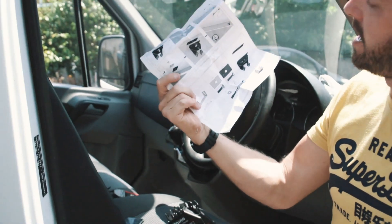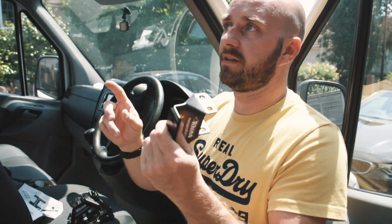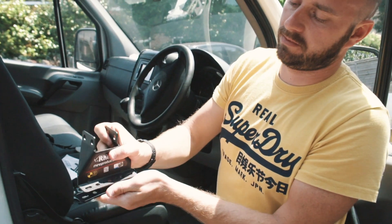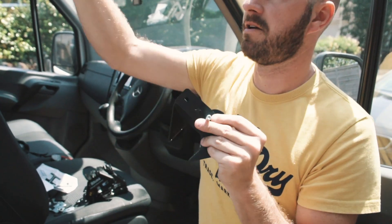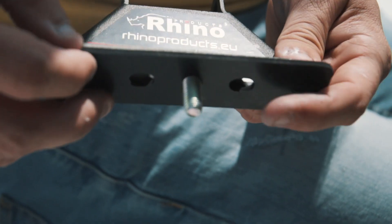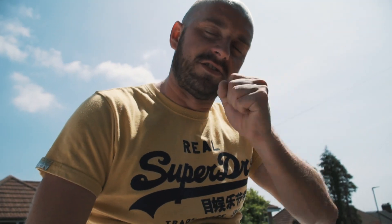The instructions are really straightforward - it's literally A4, two sides, just six images, but they're so easy to follow. It's actually one of the best instructions I've seen. To fit the bars on, you've got these heavy duty brackets. The rubber piece sits under the bracket, on top of the van, then you've got your bolt which goes through like that, through the inside of the van. Then that goes on the inside and you bolt it together for a nice watertight seal. So that's the bracket, the rubber seal, and the bolt - sits in the hole we put earlier, and I'll hold the bolt in place while Chess goes inside and uses the ratchet to tighten up.